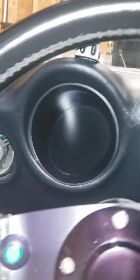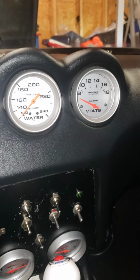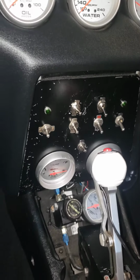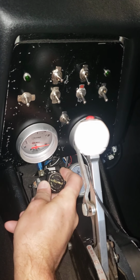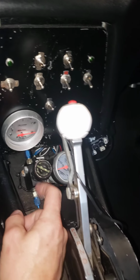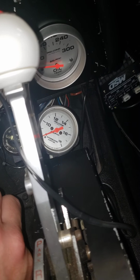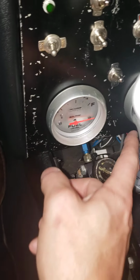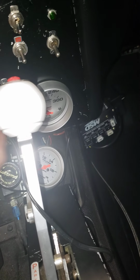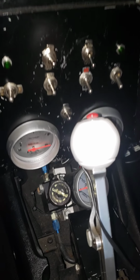So now I'll give you just a quick overview here. Got a shift light that's adjustable on the back. There's your gauges across there. Sorry, I'm hurrying a little bit because we've got the people coming. It does have the increase, decrease. It doesn't have Willwood brakes on it all the way around, but it does have the proportioning valve here. You've got your wideband ratio right there for air-fuel mixture. These 2 do not work. They were in the car when I got them. They're not connected. They might work, they're just not connected.